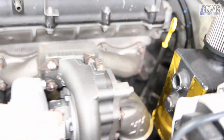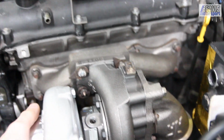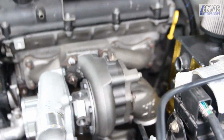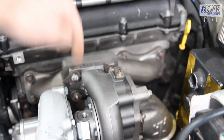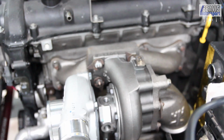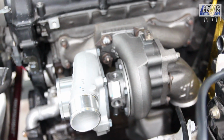Now, my feed line for the turbo comes out of the back of the head, just here, that fitting, and will easily go straight into the top here. So that's nice and easy. This will need to rotate perhaps more like that. Generally, you want the feed mostly straight down and your two cooling lines mostly perpendicular to that. So, time to do some plumbing.